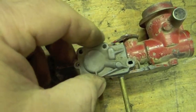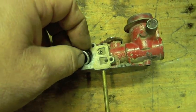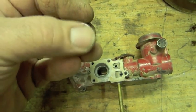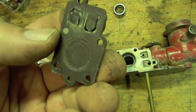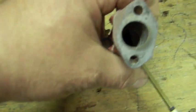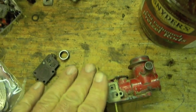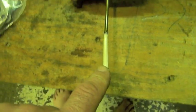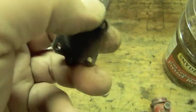There's your cover — take your four screws off and take your cover off. See there's one alignment pin. You want to do it sideways or slightly angled because there is a spring sitting here, a very small spring with a nice steel seat on it. The purpose of this seat is so you don't rip the diaphragm. This hole right here actually goes into the intake — see my finger, where is it blocking the light? Every time there's an intake stroke or a negative pressure, it pulls the diaphragm.